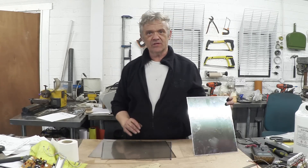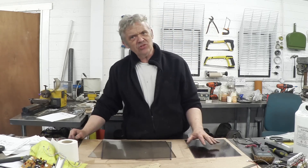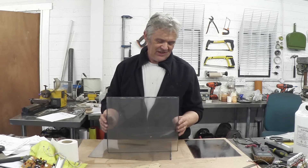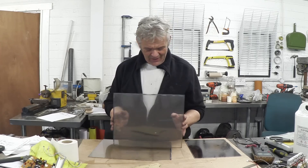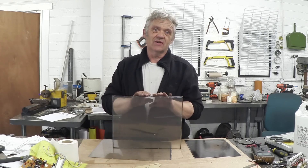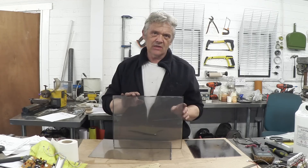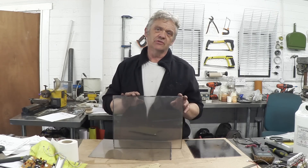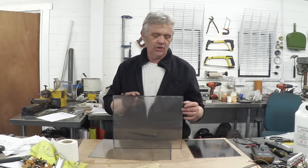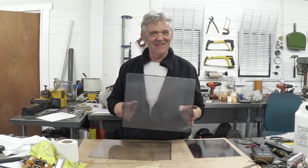The other one is actually much darker, because that's the TFT side — it's got all the transistors printed on it. It is darker but can still be used, though it's not as transmissive. Now granted, that's a lot of trouble to go to. But there's a whole load of gear you've got out of it — some lovely acrylic for building HHO generator cells, some nice lights, some good electronics. The key thing here is that ITO glass is about $3 per inch square — roughly £2 to £3, or about $3 per 25mm square — making this sheet worth about £150 to $200 if you had to buy it.